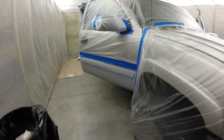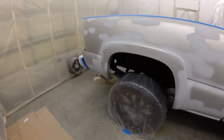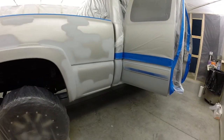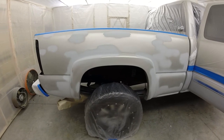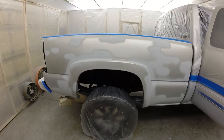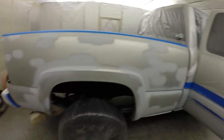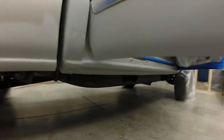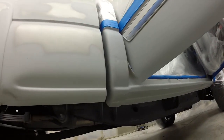I saved you a lot of dirty work that I skipped. I figured you guys didn't need to see the nasty stuff I had to do to the truck. We now have solid cab corners, new rocker panels, and I went around and feathered out all the chips and scratches and spot treated it with primer surfacer. We got everything in 320 grit so we are ready to lay down the sealer, the base coat, and then the clear coat. I got it all taped off — anything that I care about getting overspray on. See the new rockers and cab corners, nice and solid, everything was replaced with new sheet metal.